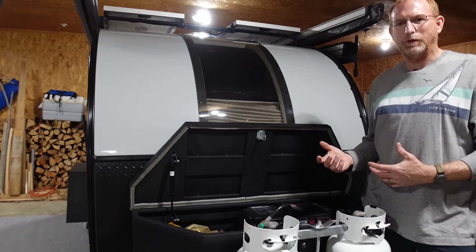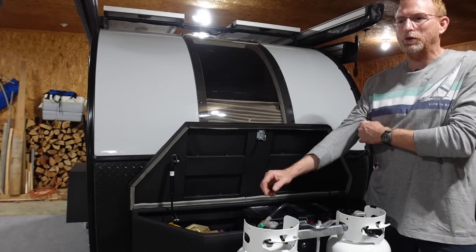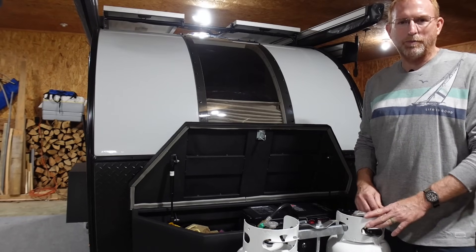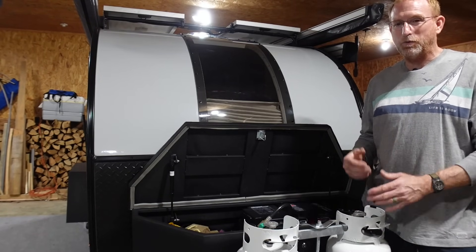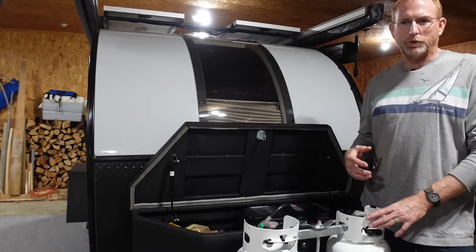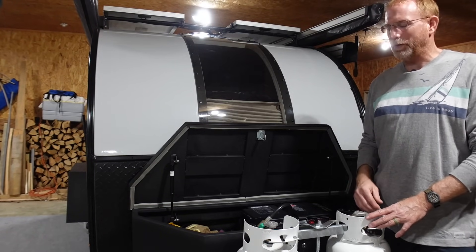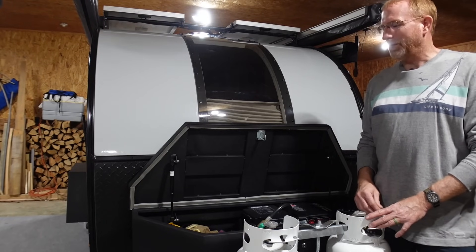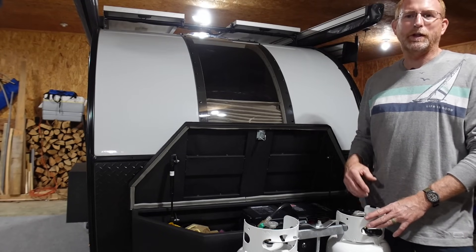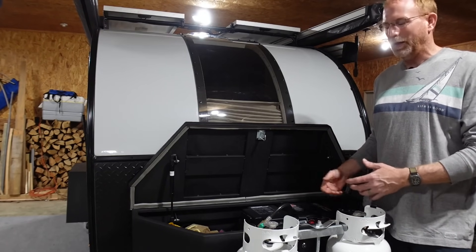As I used the camper, I followed the power usage with a Victron Bluetooth 500 amp shunt so I could see how much power we were actually using. I realized a couple of things: one, we don't consume mass amounts of DC power, so the idea that I needed 200 or 300 amp hours of 12 volt power just wasn't the case. Two, the 12 volt lead acid battery fell below 12 volts so quickly — it got down to about 50% and you're below the 12 volt range, which isn't good on your appliances.